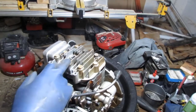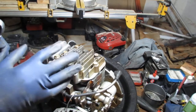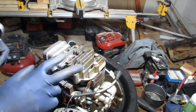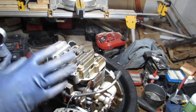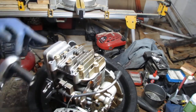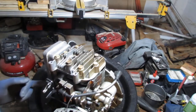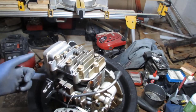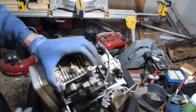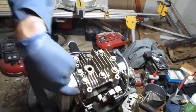So this uses 140 inch-pounds, which converts to 11.66 foot-pounds. And this engine is a 9000 series, so it's a 9067 series. That's how I know. So you gotta look up your engine block information. You get that information from the side of the engine over here. It has the number and the date of manufacturing right here.